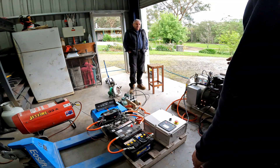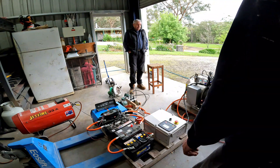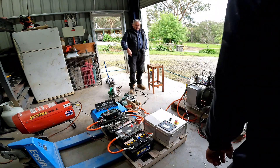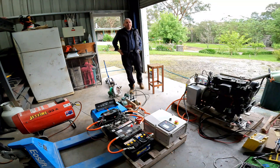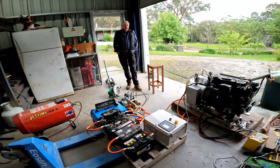It's a 400 amp alternator so it can pull a little bit more yet. We pulled up to 99 amps — so when you had everything running it showed a peak of 99, about 100 amps coming out of it. Well, it can do 400 amps at 3,000 RPM — that's 5 kilowatts.